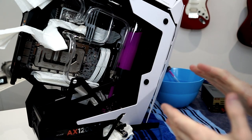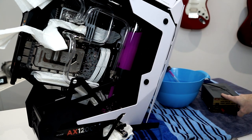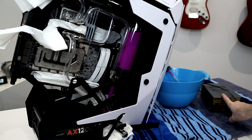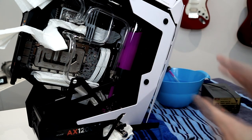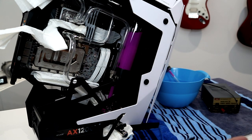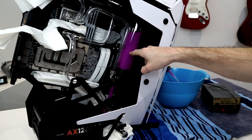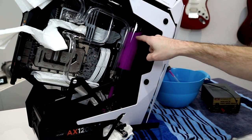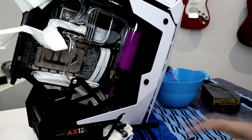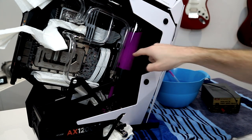We've filled up enough that we can do our first pump turn-on. What I've got it connected to is just an external 12-volt power supply, which is enough to drive the pump without powering anything else — we obviously don't want power running through all our other components while leak testing. We'll switch the pump on; it's going to push the water down. As soon as the water level starts to get low, we'll switch it straight back off and refill the reservoir. It should start pumping through and push all the air out.